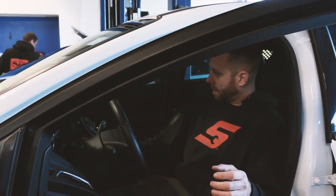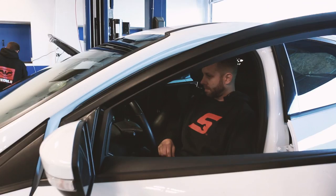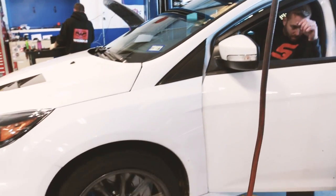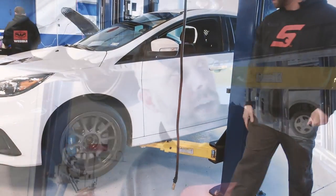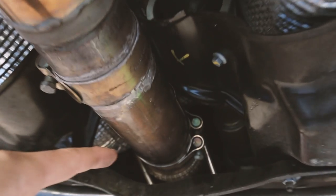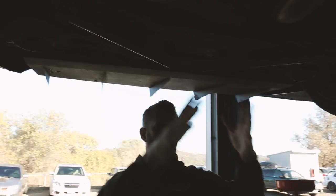Alright, so we're just going to turn the car on and put it in gear. Got the car in gear — you can see the PTU turning the drive shaft, and all the way back here we've got it spinning the RDU and spinning the rear axles. Okay, so this is all-wheel drive mode. Everything's locked up and moving — so you've got all that drivetrain loss. Now we're going to show you two-wheel drive mode.